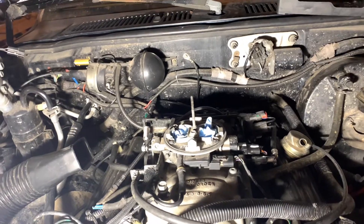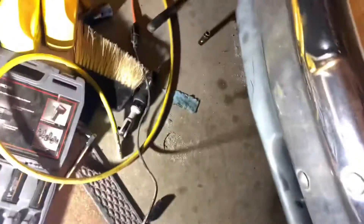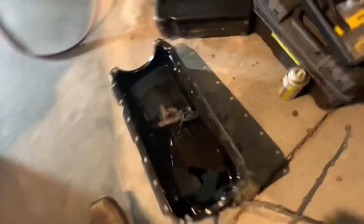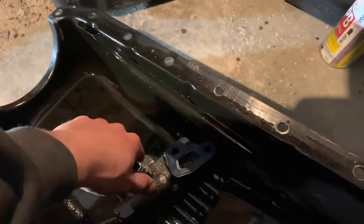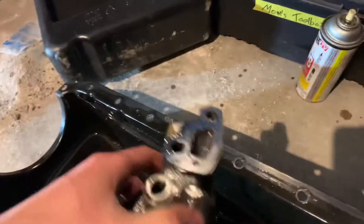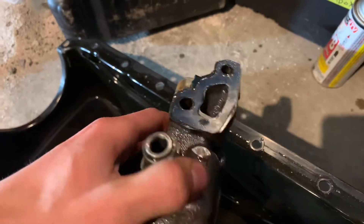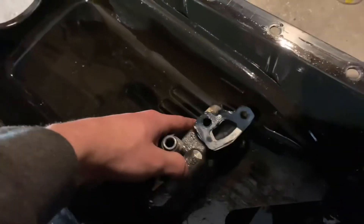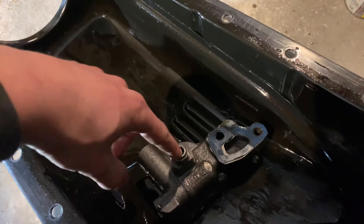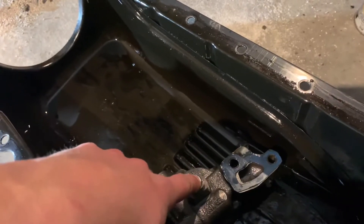The easiest way to check the oil pump is to just pull it out and inspect it for damage. A failing oil pump — this is the oil pump I just pulled out, it's not broken but we think it might have some internal issues. Usually a failing oil pump will have this little bushing crack, and then the little hex rod won't be spinning the oil pump anymore. That's the second place your oil pressure system is going to fail.